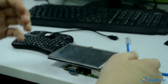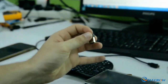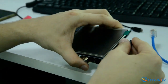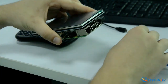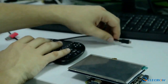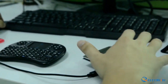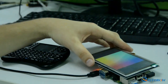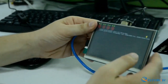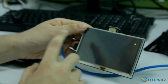The next step will be to connect our Bluetooth keyboard adapter. If you don't use a Bluetooth keyboard, just connect a normal keyboard and mouse or connect by SSH. We will also need to connect the Raspberry Pi to the network to be able to download the package and the driver online. The last step is to connect the power and turn it on by clicking the button. As you can see the screen may have some black bars on the side, things not well aligned, and the touchscreen will not work without the driver.